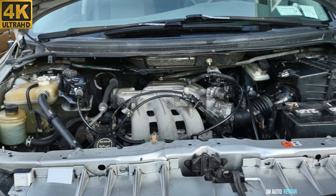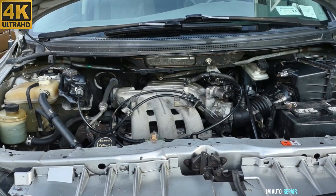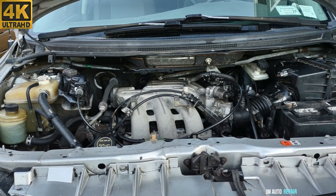Welcome back to my channel. The diagnosis I'll be doing in this vehicle will apply for any make, any year, any model. I don't have any codes stored in the PCM — the PCM is clean — so I couldn't find any information there. I'll be diagnosing the problem by doing some tests. I suspect the catalytic converter is clogged, or it could be a transmission problem because the gears are changing very late. The engine is shaking a little and the car will not accelerate at all.